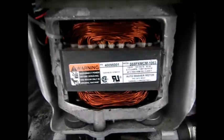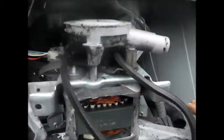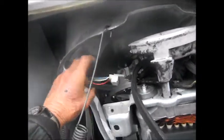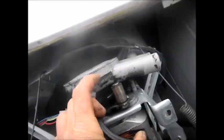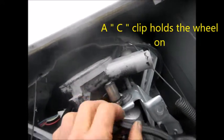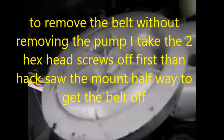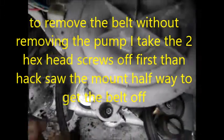And there's a little disclaimer for you — don't try this at home, consult your local professional. Okay, so I got the motor out. I had to disconnect the clip-on wires here — just push that and it comes off. I'm gonna leave this belt sort of in place so I remember where it goes. In order to get this off, there's a screw on the top and then a nut on the bottom. There are basically three hex head bolts that you have to take off.